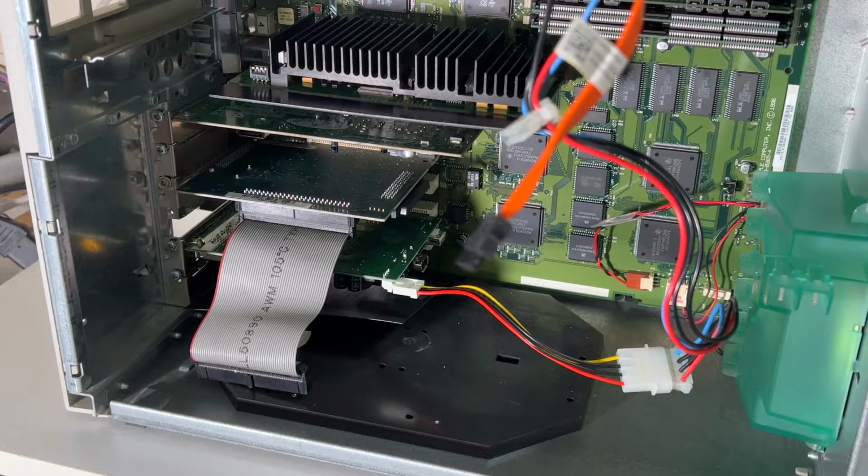So he found a SATA card that would work, an SIL 3112 based card from StarTech on eBay, which was awesome. It was a little bit more expensive than the generic Chinese ones, but it was also in the US, so it would get here within a couple days rather than a couple weeks. So we bought that, and it was weird because it was a card that had a SATA port mounted externally. And I don't mean eSATA, I mean original, actual SATA. Almost like you'd run an internal drive externally for some reason. Maybe this was before eSATA and that's how it connected. I don't know why that would be, but I don't remember that far back at the moment.